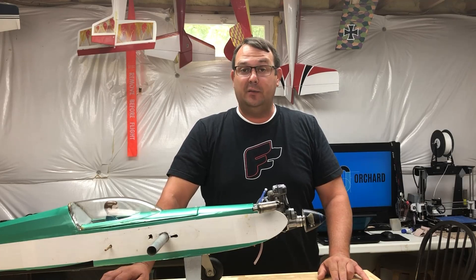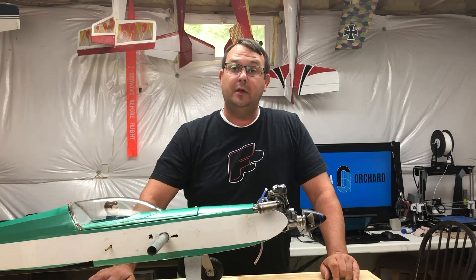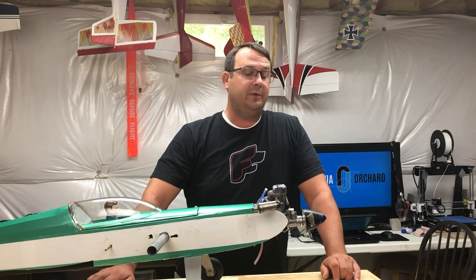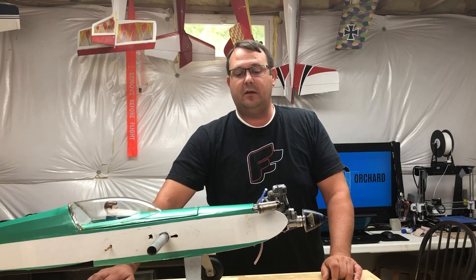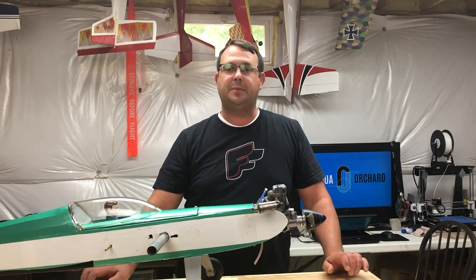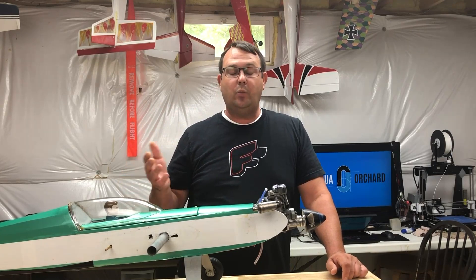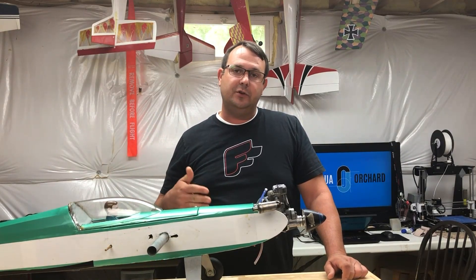Having a club and a knowledgeable member of the club has been an invaluable resource. If you have access to a local club with someone who is familiar with engines, it's worth your while to utilize that resource. I had flown glow when I was a kid and did not remember anything — I was all self-taught, not a member of a club. Getting the basics down on how to tune these engines was a bit of a learning curve. You want to, as much as possible on an unknown engine, try to return your low speed needle valve to the factory position, which generally is a little bit rich. Once you get the engine running, first tune the high speed, then adjust the low speed after that.